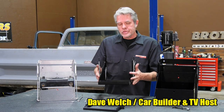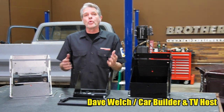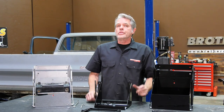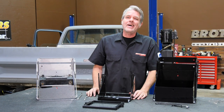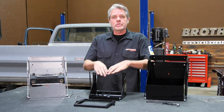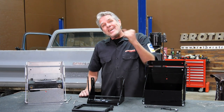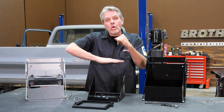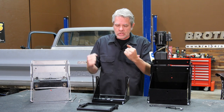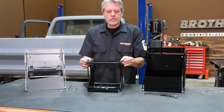This is a really typical battery tray you're going to find in these trucks — 1947 to 1955 first series. The problem with this is that it typically rusts out, and it was only made for a six-volt battery, which is smaller. Sometimes it's hard to find a 12-volt battery that'll fit, and you have to access it from the floor of your truck — pull the carpet back, take things off. It's just kind of a drag.